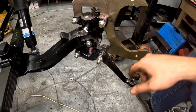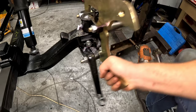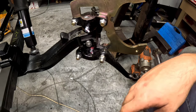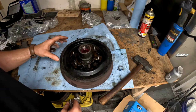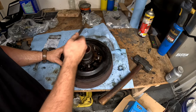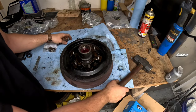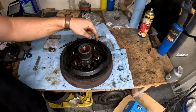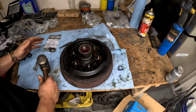Now we have full clearance. I'll grind back a little more for comfort — don't want any binding while steering under load. Good clearance achieved. Before we start painting, let's get the hub separated from the drum. The kit I got utilizes the original hub. You need to press out the studs and drill out the three rivets. I don't have a press, so I'm going to try hammering the studs out — I should have soaked them in PB Blaster but didn't.